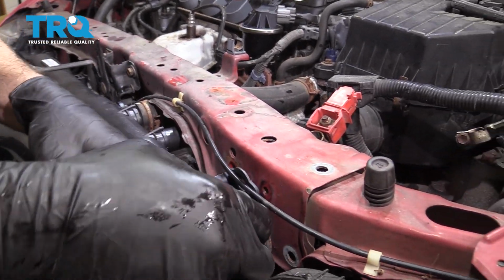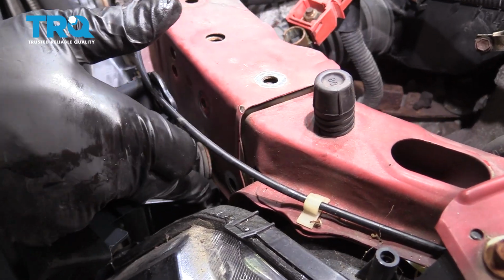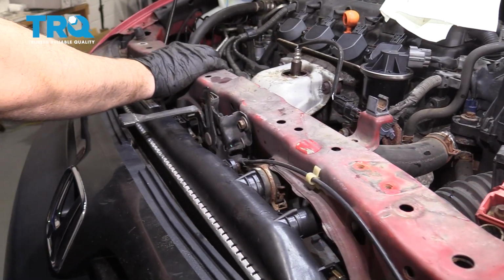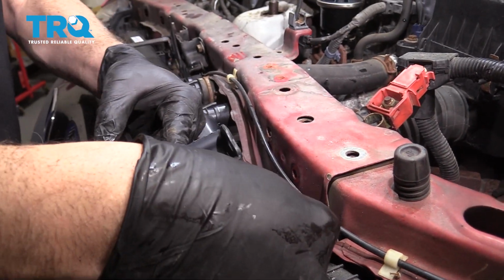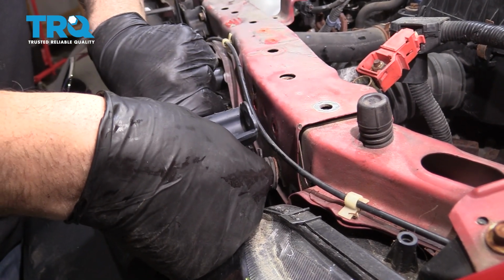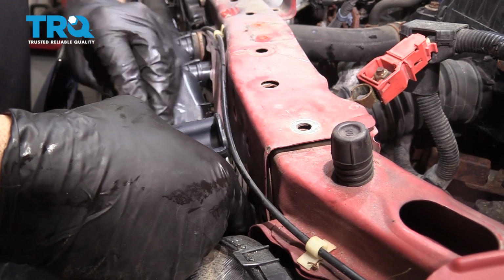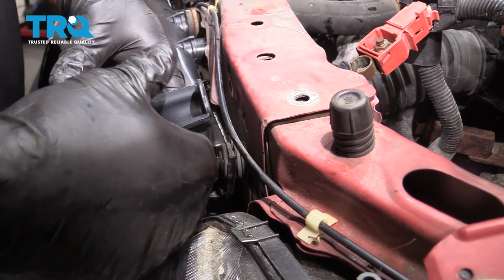Now on the installation, you want to pay attention to the condenser bushings here, because there's a mount there for bolts to go through. Make sure everything lines up on both sides. I did put a little bit of anti-seize on the end of the bolt for the condenser hardware here. Line this up. You can lift this up, get that bolt to line up inside the frame there, and go ahead and start spinning that in. I'm going to repeat for the other side.